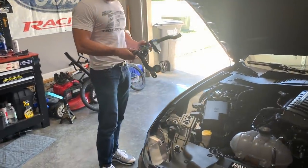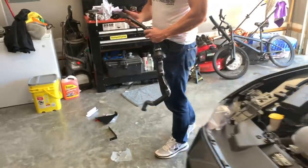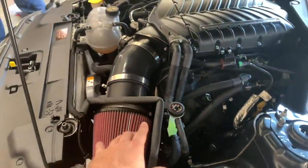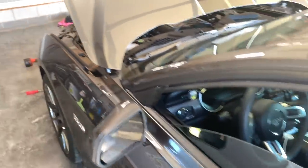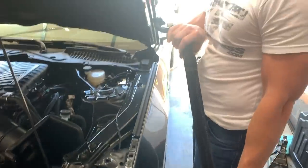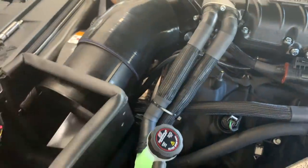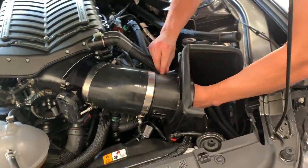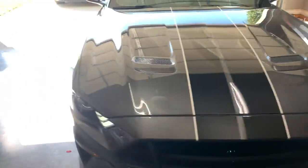Next thing on the list is the sound tube that we're going to do for his Whipple. We're going to route it basically down here like the normal sound tube — it kind of cuts, so we have a measured length. You're going to cut it back and then it drills right into the intake, kind of like your normal sound tube would. Then long story short, we're going to go inside the car, pull the accelerator pedal area away from the firewall with some spacers, and it should give us a lot more noise. Should sound really good. Sound tube is done — he's going to pull the car out.